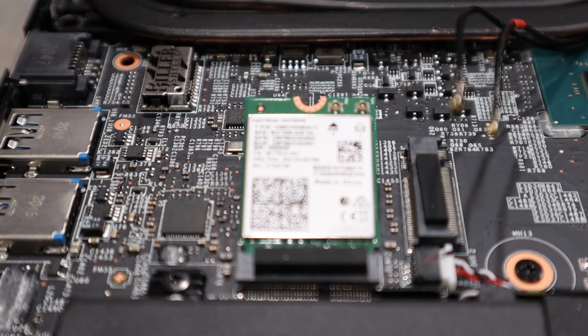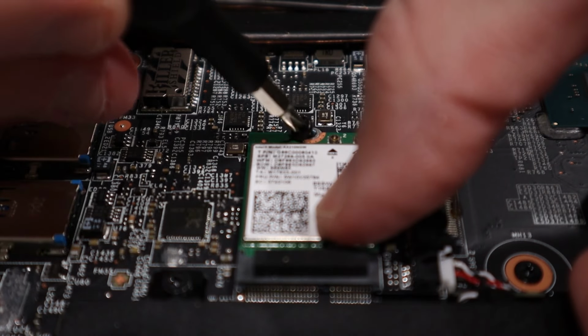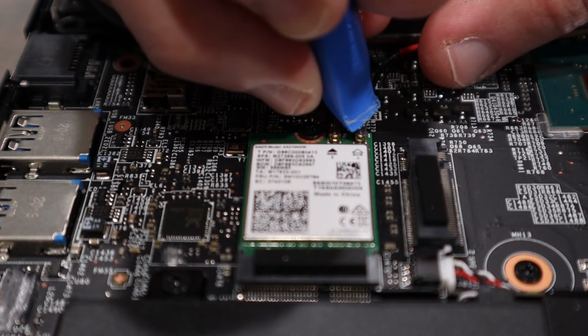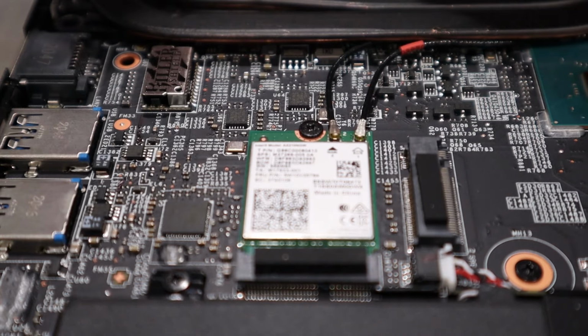Make sure you know which antenna plugs into each socket on the Wi-Fi card. Hopefully you have good eyes here. You'll want the antenna attachment point to be centered and level before pressing it onto the Wi-Fi card. Otherwise, you will run the risk of bending these tiny parts. You'll hear a satisfying click or pop, and then it's secure.